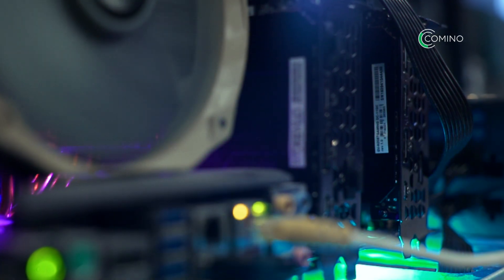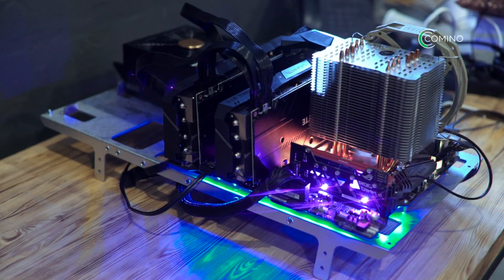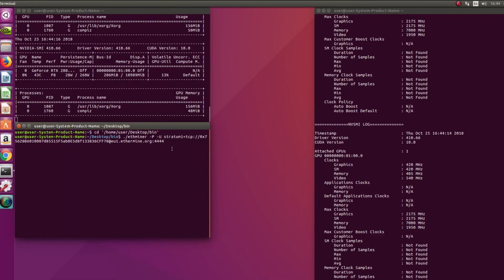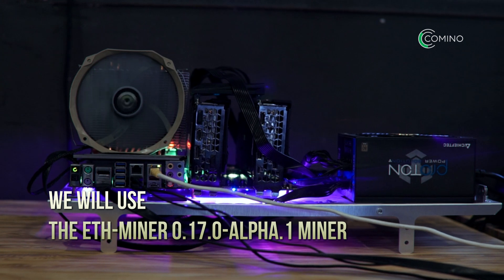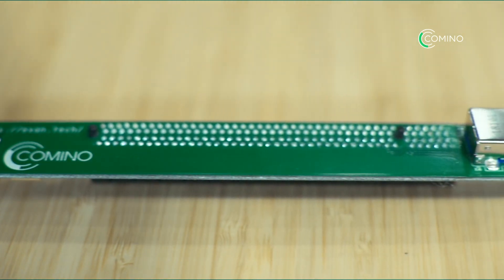Let's now test the video cards while mining without overclocking them. On TensorFlow, the 2080 Ti turned out to be better than the 1080 Ti, but not enough to cover the difference in price. We used Ethereum, which is the baseline crypto when it comes to checking mining potential. As we did before, first we'll test the cards when they're directly connected to the motherboard and then through a PCIe riser, to deduce if the speed of the bus impacts mining. We will use ETHminer 0.17.0 Alpha 1. You can check the table for results. The 2080 Ti delivers the best results with 50 MH/s, but the 1080 Ti is not that far behind with 40 MH/s — a 20% difference. When using a PCIe riser, the results remain the same.